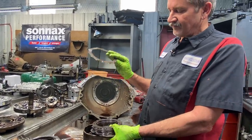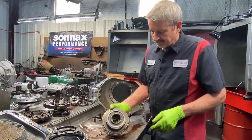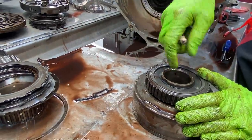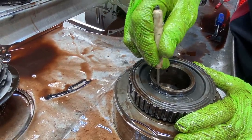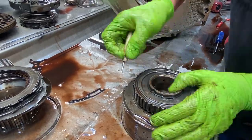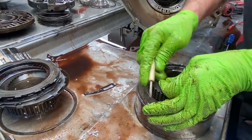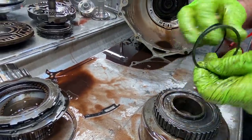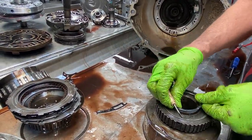We will be leaving this wave in here, because if we don't put this in there when he puts it in reverse you can jar his teeth. We have our sprag assembly here — this is like a wire snap ring, it's like a spring. It's got a lock on it right here. What we do is try to push that so the lock is in this little dip, that way you can get it out. To lock it back, you'll get it lined up, push it down, it'll clip, and then turn it to the side so it can't come unlocked.